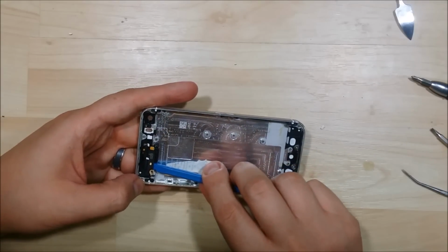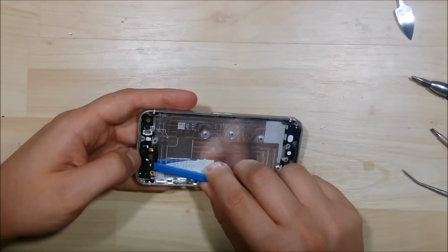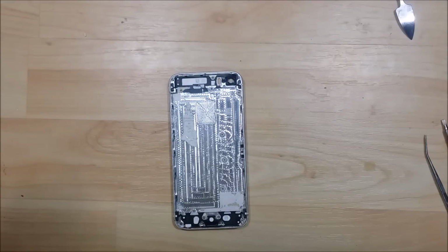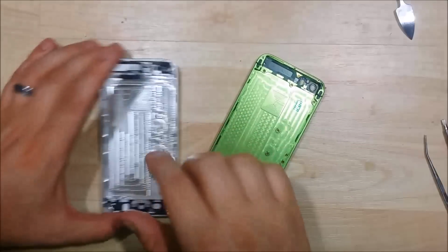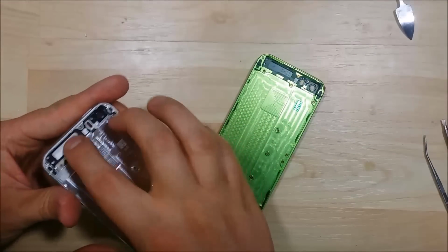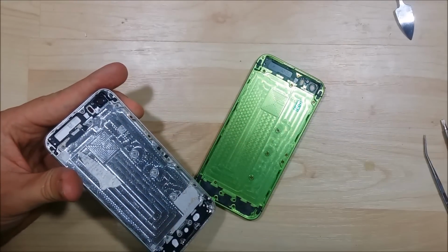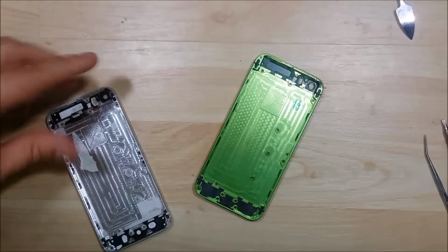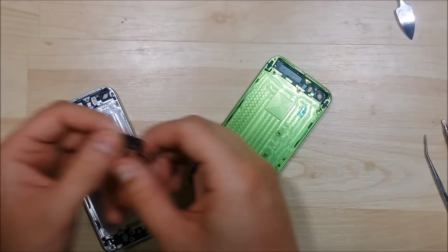And here's where my camera cuts out on the recording. So really what I did is I removed the Wi-Fi antenna, and then that was the last cable inside the device. And then down the sides of the device, all the connections, I just removed this portion right here, the Wi-Fi antenna, and then any connections or screws and ports that were down the sides of the phone that the screen clips into. Here's the cable that was removed, just from right here.